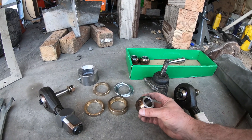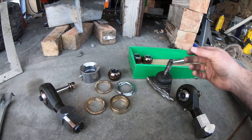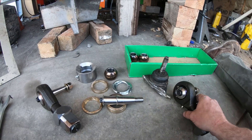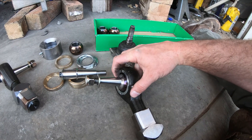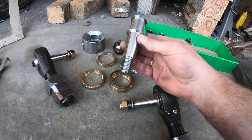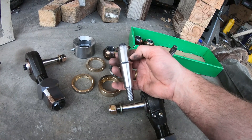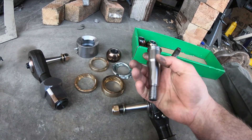I couldn't do that, so I went to my local machine shop and told them my plans — that I needed these drilled out, and they're hardened so it may be a problem, and I needed new pins. Look how beefy those are. It has the same taper as the bottom, and you can tell especially with the taper how much thicker it is — it's an inch at the top. This is beefy, that is monster. I don't know anything or anyone who makes an inch shaft going through a uniball, so this is going to be extra strong.